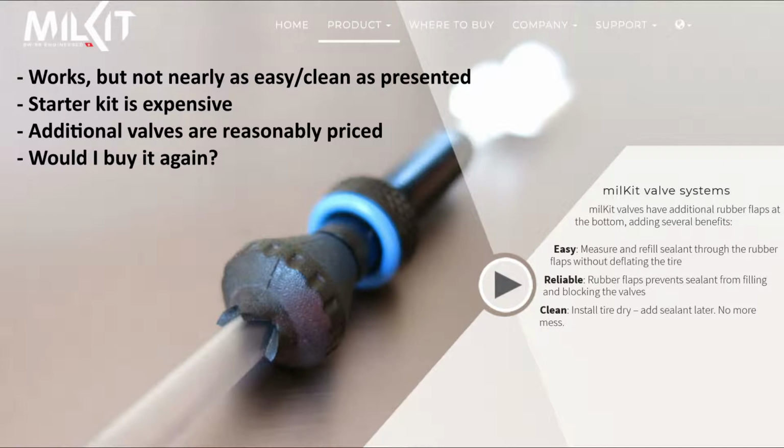All right, so final thoughts time. So the system does work. It does work the way that it's supposed to, but not quite as easy or as well or as clean as milKit presents it. Obviously marketing is marketing, so there is some room there to give them some slide. But I did expect it to work a little bit better, especially when it comes to the leakage when the core is out. They present that in a way that makes it so that you won't get anything coming back out of there, because the sphincter at the bottom should seal that out. And clearly it didn't work that way.